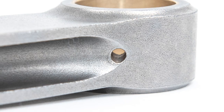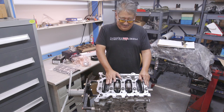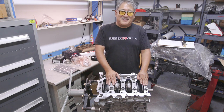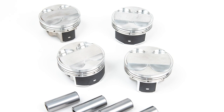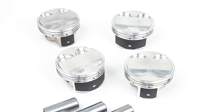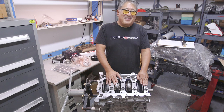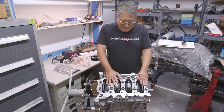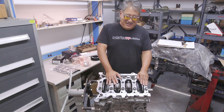This is a great rod especially for an engine like this — not an all-out record breaker, but one that sees daily use and some track use. For pistons we're using JE FSR pistons and running close to 12 to 1 compression ratio, which is about the most you can get away with on our California pump gas. In other states with 92 or 93 octane you could run a little higher, but this engine has to run reliably on the worst gas available.